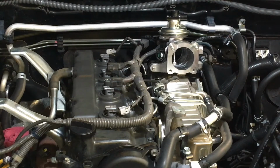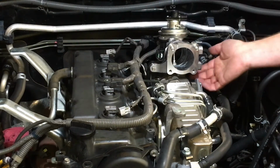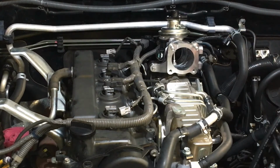Okay, now that we've done up all those, this is a common one people forget, right? We've done the 3 bolts there, the 3 nuts there, that one there, the upside down ones, the mounting one, and then we've got to put the plug back on the common rail, right? So that is the next step. That's why we stop and think about it. We could have moved on to the next step and missed that one. Hear the nice click, that's what you want to hear. Give it another pump while you're thinking.